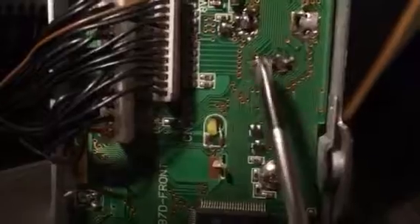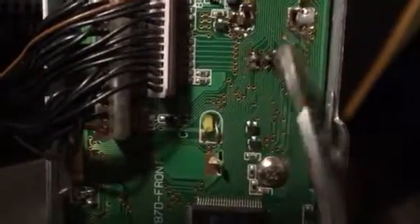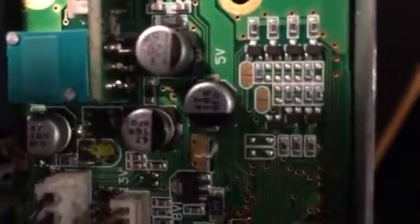So basically it's unsolder one, two, three, and desolder these lugs. I've still got to brush these contacts - will be able to put back on to test it. If you're interested in doing the mask cap mod, this is where you'll find the bank of resistors that need affecting, changing, or removing. I'm not going to do it, I'm not interested in it - if you want to do it, that's where it's done.